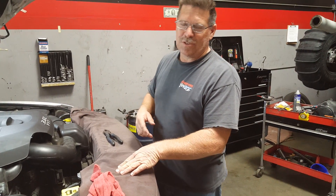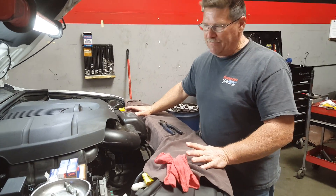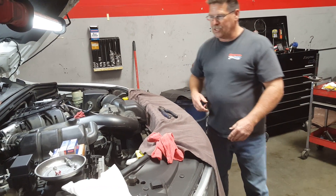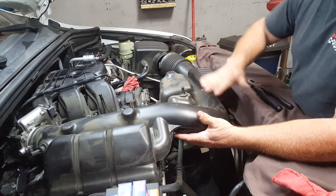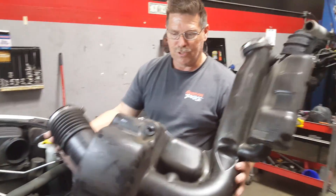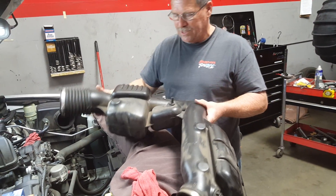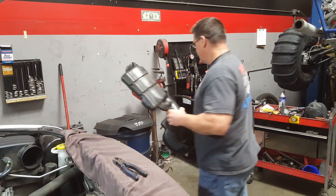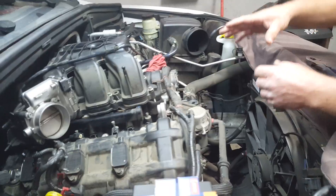I've already done the teardown, so you won't see me use tools in this video. The first thing you need to do if you have a leak coming off the back of the engine and can't find it is remove your dust shield — basically the splash shield for the top of your engine that keeps noise down. Next, remove your air intake hose that goes from your air filter box to your throttle body unit. It snaps in with a ball socket and rubber bushings — no bolts necessary. Just unbolt your clamps, pull your electrical connector off the intake air temperature sensor, and set it aside.